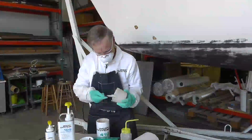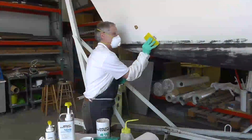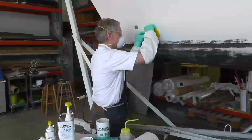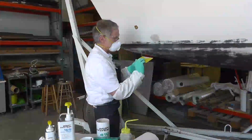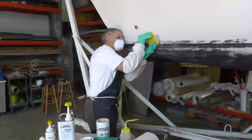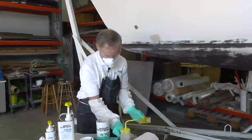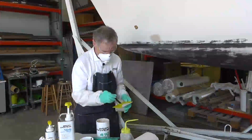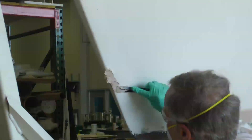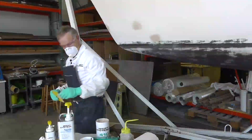It's all set now. I'm going to take some and apply it to a plastic spreader, then go ahead and apply it in the middle, kind of press it down, and go back to the middle and press it down — always working from the middle toward the edges. Now if you don't mind sanding you could leave it like that, but I don't like sanding if I don't have to. So I'm going to bend this spreader so it matches the curve of the hull, and then draw it across. Now there's not a lot of excess epoxy to have to sand off. So come tomorrow, we'll sand and be about our business.